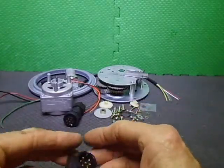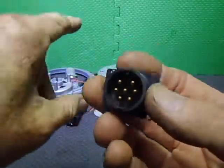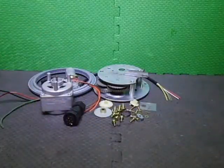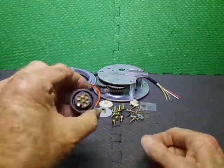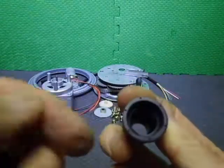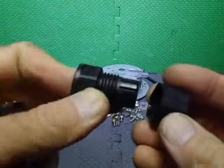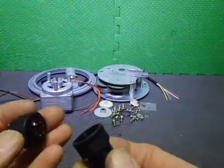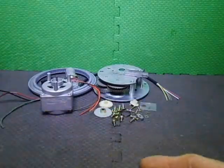The reason I'm using the 7-pin is because I'm going to be wiring the limit switches and the return for the limit switch LED in the controller. There's the LTW plug - it's basically a 5-piece assembly with a little washer, and there's a gland in the back. They are IP67 rated. It all screws together - all ABS or high-impact plastic.